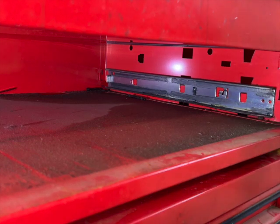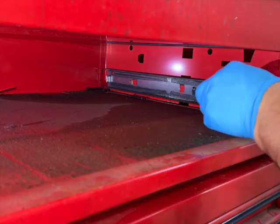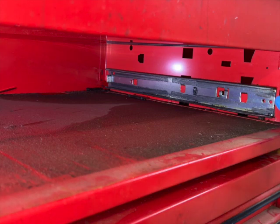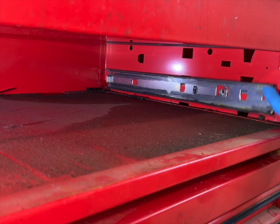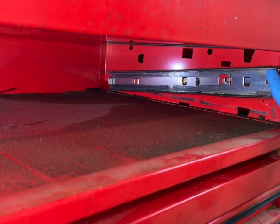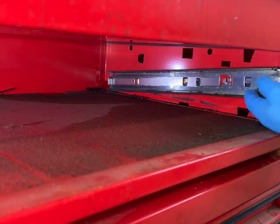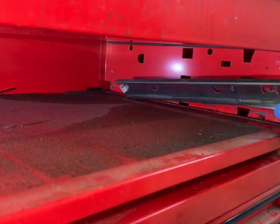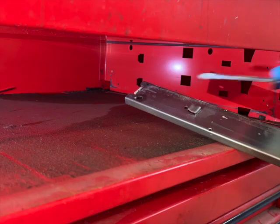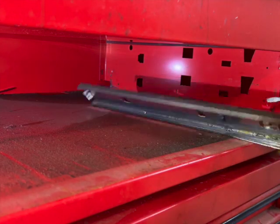In the other video the guy was banging on this, but all you're going to do is take this little tab right here, put your screwdriver in there, and bend it out. This is your old rail. You bend it out and then there are little hooks on the sides — you just lift it. I just lifted it with my little finger. I didn't use a hammer, I didn't use anything. I lift it and pull it out.